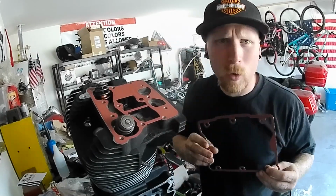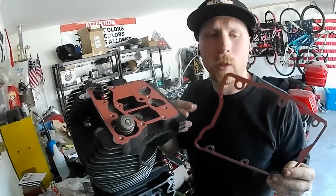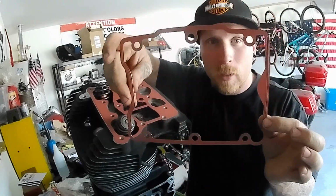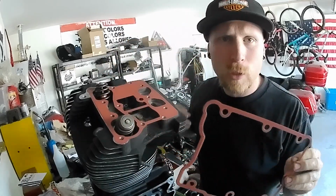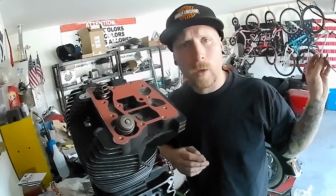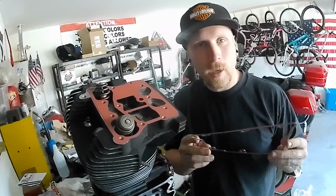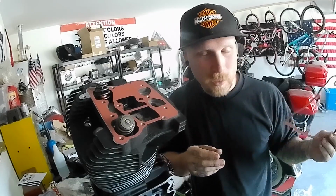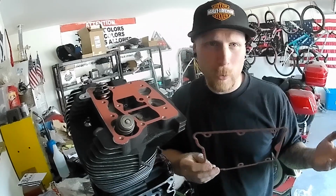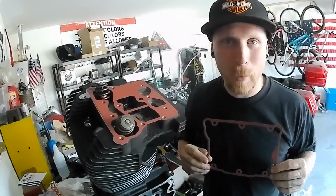Ask me how I know, because I've been in a rush before and stuck stuff together. That's why I stop if I'm not feeling it. These are directional too. One day I got a bike all done up, started rushing because we had a little run to go to down the streets. I was trying to make sure this guy could go with us, and I put his gasket on backwards, and we got down to where we're at. He's like, dude, this thing is pissing oil everywhere. I saw what I did. I was able to fix it right away, but yeah, that'll make a mess.